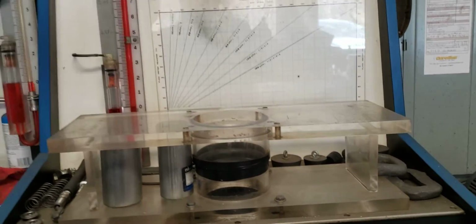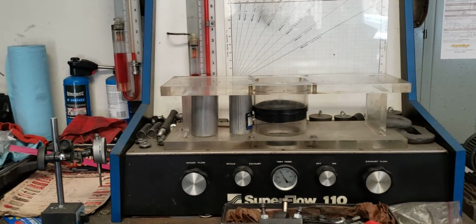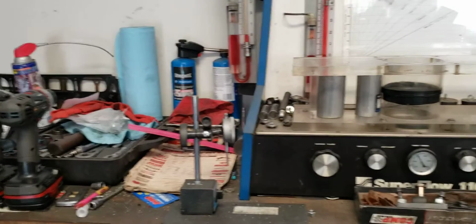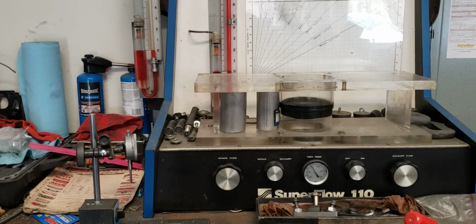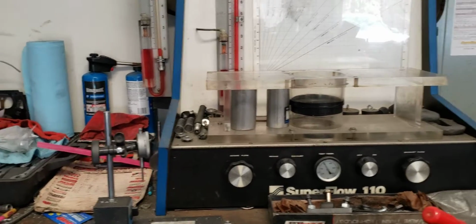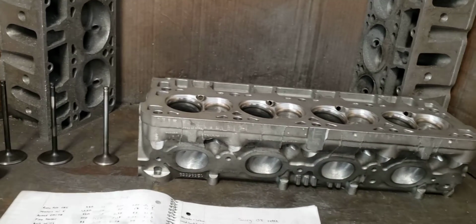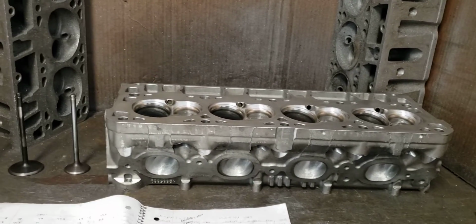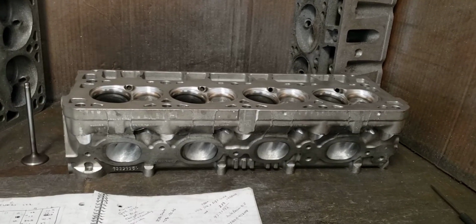You have to think that the intake valve is going thousands of RPMs a second, opening and closing. The other thing we have to consider is that air is stacked up behind the valve ready to go in as the valve is being opened and closed. So port crash, in my mind, really isn't all that important. I haven't seen it pan out in a car, on the track, where it really made any bit of difference, to tell you the truth.